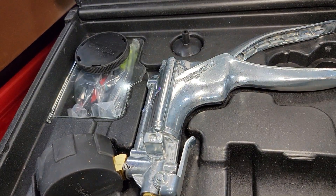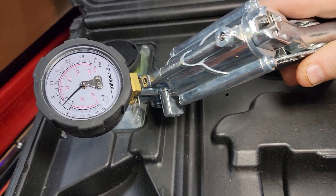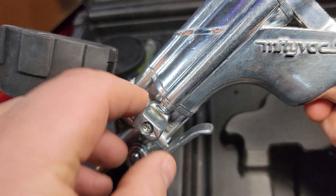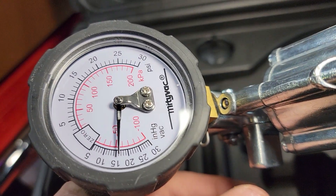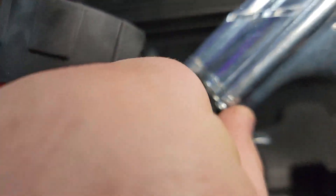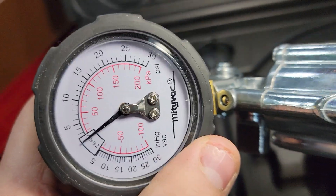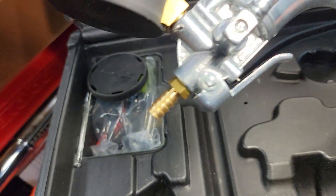What I didn't see covered is what the actual tool does best - that's EVAP testing, sensor work, doing pressures on your turbos, blow-off valves and stuff like that. If you look here, it's got a little switch on this side - if I hold my finger over here, you can see the gauge showing your inches of vacuum. This tool has a little switch right here that switches back and forth for vacuum or to blow, so you can put pressure or pull vacuum.